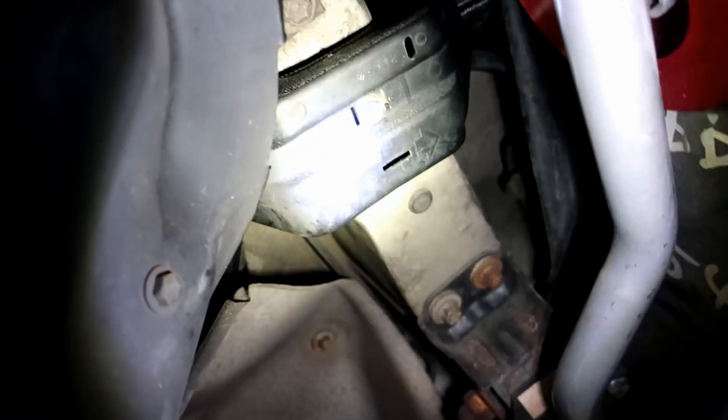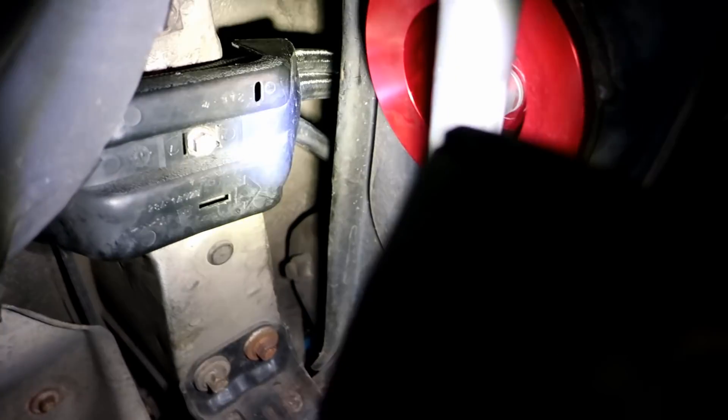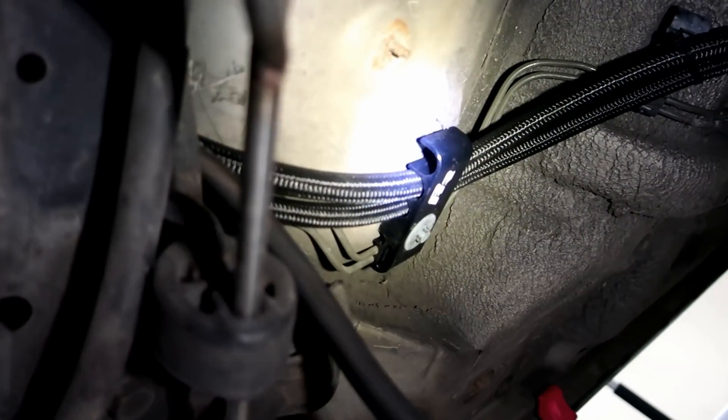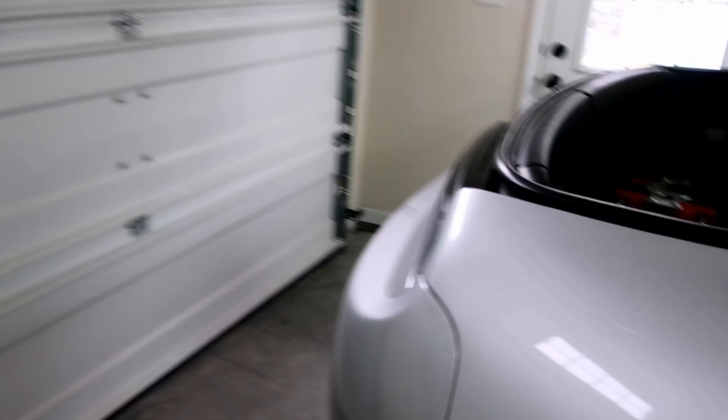You can see the black wire running there — it's coming out through there underneath the heat shield, just like the fuel lines are there. So if you're wondering if it's too close to the exhaust, the fuel lines go the same way. Then I ran it up through this plastic piece here where the brake lines are on this side and the fuel lines on the other, so it separates them. It comes out right there — see the electric line? And the fuel lines are there. Now it's coming down and sitting here. Next up is me routing it, zip tying it away, and then using these Powerhouse Racing brackets — they have that extra spot right there, and that's how I'm going to run the power lines beside it the whole way down, separated the whole way through.